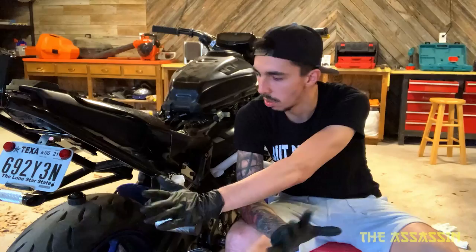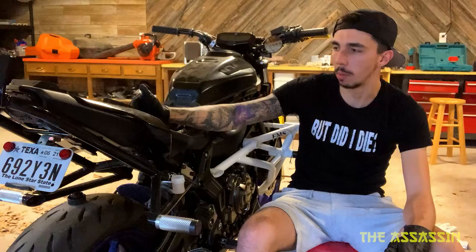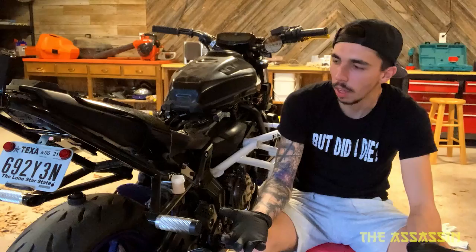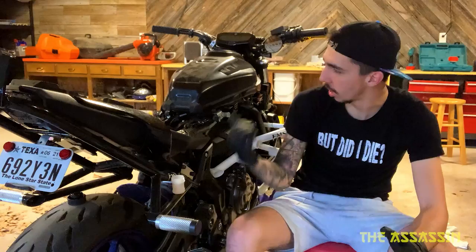This bike is ABS and these lines are for non-ABS, so I want to take you through my process. The ABS sensors — I've been told I can leave them plugged in since I have my ABS fuse taken out. These sensors also clock your speed, so if I take them off I won't have a speedometer. This is a legal street bike, so I want to keep my speedometer working.